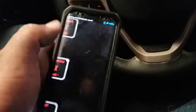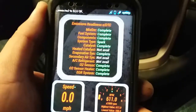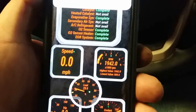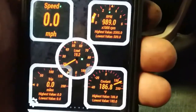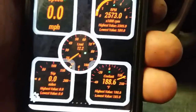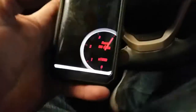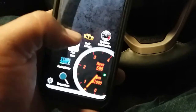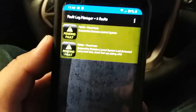You can customize all these screens. When we need to do smogs, the drive cycle is complete and all the monitors are complete. It shows engine speed, engine RPM, live accurate data, engine load, miles, and coolant temperature. To clear the check engine you go into fault codes. I'm looking at the screen as I'm doing it — and there it is, there's two of them.